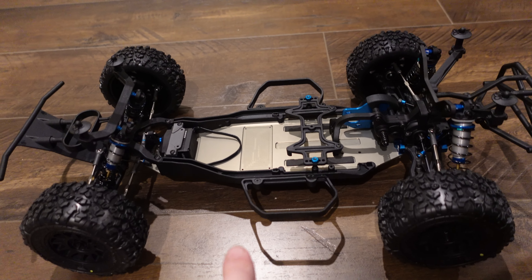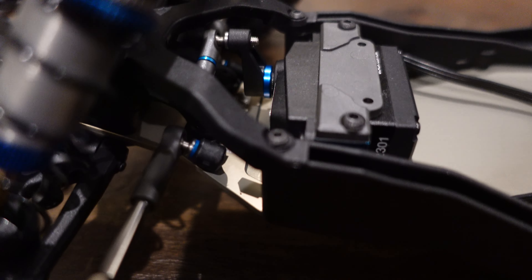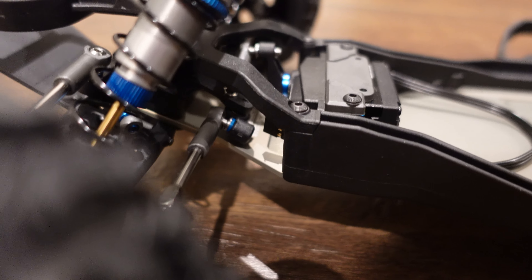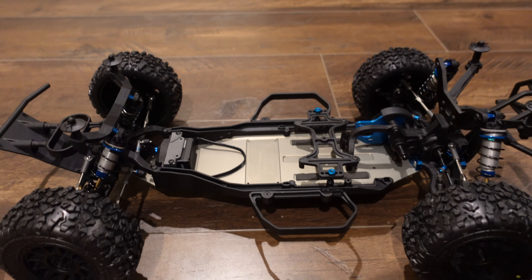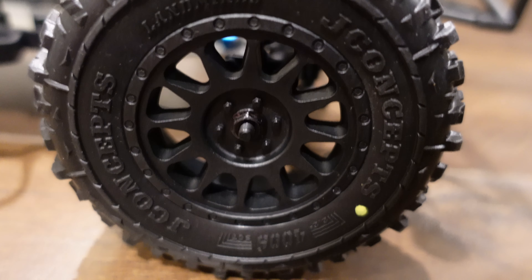It says it's got a short course length aluminum chassis — that was a 22-degree kick-up we're seeing down there, which is a lot. It uses the B74.1 two-piece rear hubs, which basically just slip over the constant velocity drive, and then there's a big aluminum hex nut that goes over that. You can kind of see it on this end.